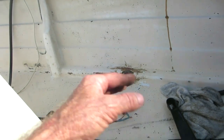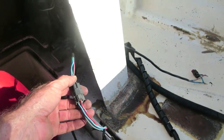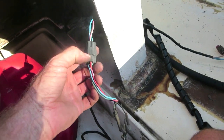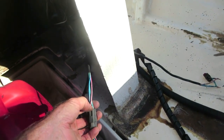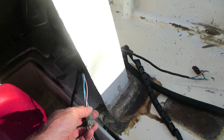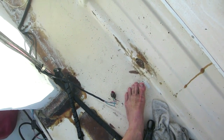12 volts on one side runs up, 12 on the other side runs down. I had 12 volts coming in — and mind you this was hours later — but my little terminals were pulled out. This is a 1968 boat; I haven't run this thing in two years. I was having trouble — only had up-tilt for a while, intermittent trim and tilt. Been chasing this for a while, finally got around to solving it.